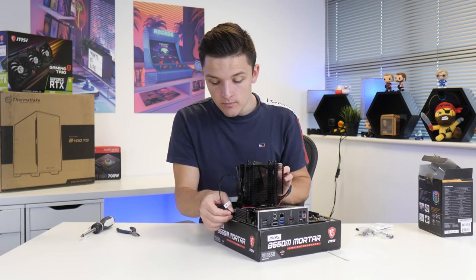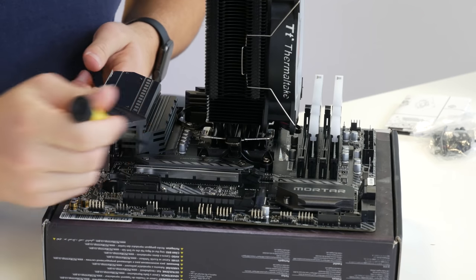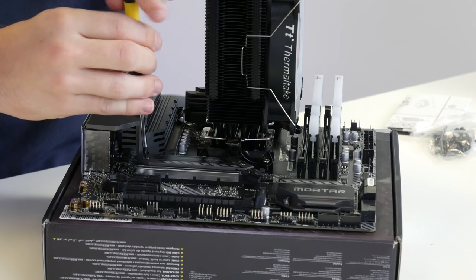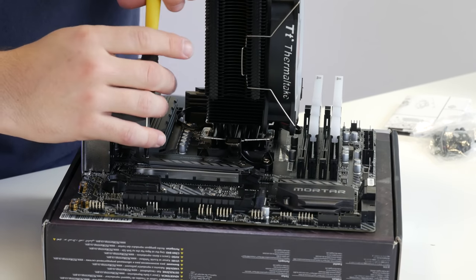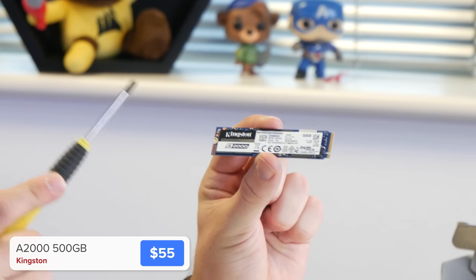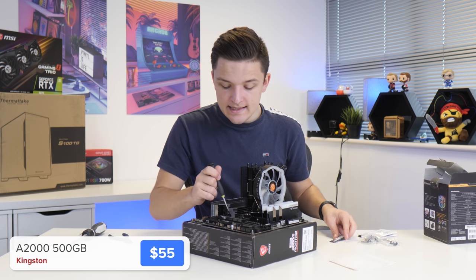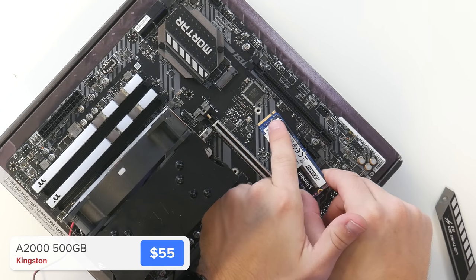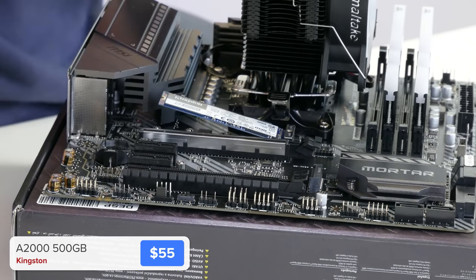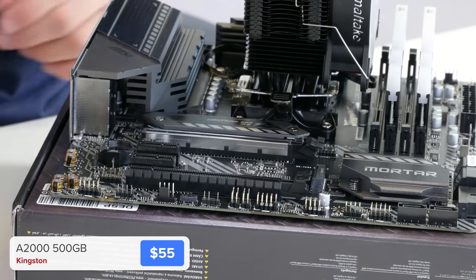Remember to plug up the CPU fan header. While our motherboard is still out and easy to access, it's also a good idea to install the M.2 drive. This is going to be our primary storage drive today and provide about 500 gigabytes of fast and affordable storage. Specifically this is the Kingston A2000 — a really affordable drive that sits on the NVMe platform. We're going to line up the notch on the gold interface with the notch on the M.2 slot, slide the drive into place, fasten it down, and reapply the heatsink.